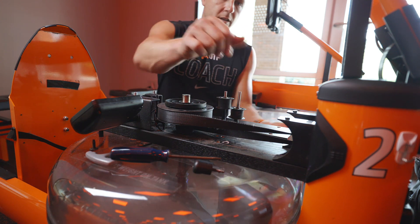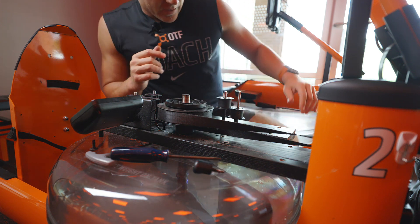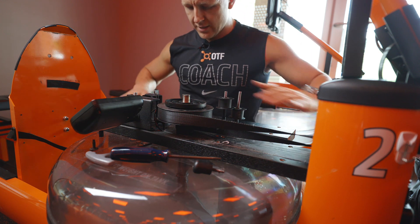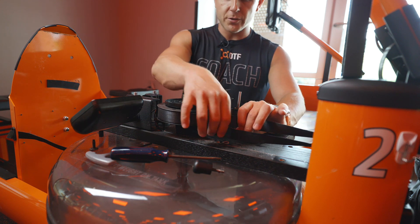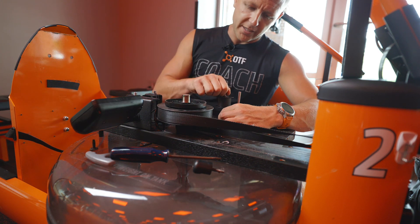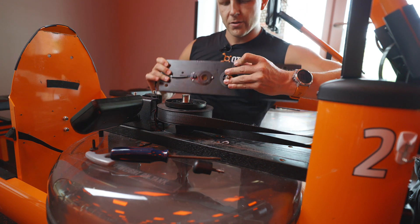Let's talk reinstall. When you go to put this back together, let's remove these little plastic pieces — we'll put these on later, it'll be easier. Both of these cables run in the middle of these pulleys. So when putting those back on, those cables both need to be in the middle. I'm going to show you and take these out one at a time because it's a lot easier instead of trying to work with the entire unit.